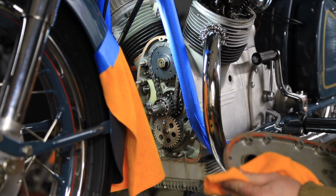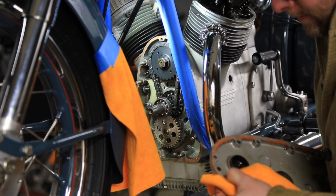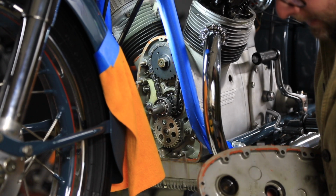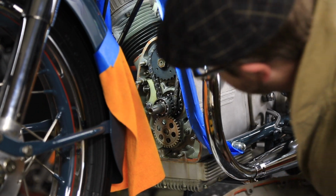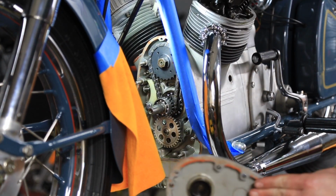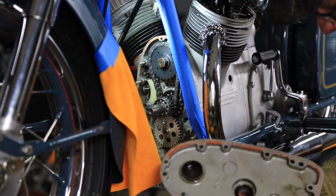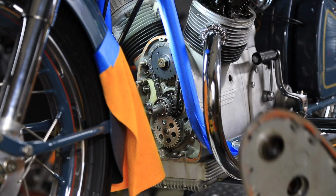The only thing is that I think I might see now, as I'm recording this, why they used RTV instead of a paper gasket. And that is because the mating surfaces here are not perfect. It's a little bit beat up, it's got some scoring. I mean, it is from 1954, and who knows who did what to maintain this thing while it was in service. We're doing some archaeological mechanicking here, where I have to decode why things were done at what period of time, and if it was done for a reason that can't be circumvented.